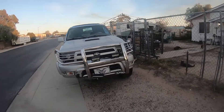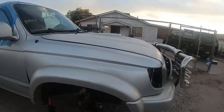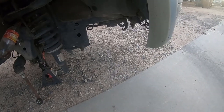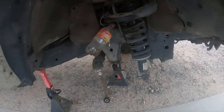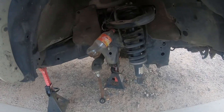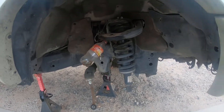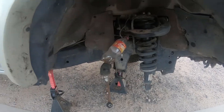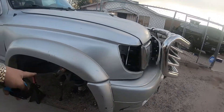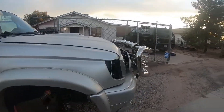We got some stuff to do on Sky as well. I'm just gonna turn this into several updates. I got new lower control arms all painted up — they're actually 20-year-old control arms I took off this truck. I was doing a front-end refresh and those were perfectly fine; the bushings were fine, so I just repainted them. We've got to put a control arm in, and I need to go to Eric's West Toyland Auto to get a spindle. I have lower ball joints and upper ball joints for this side.